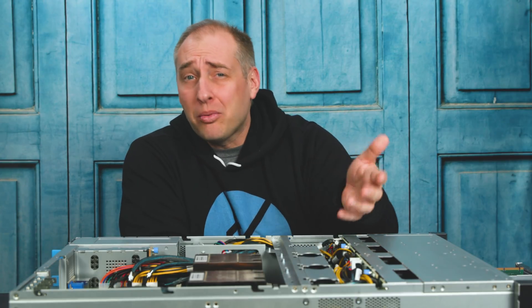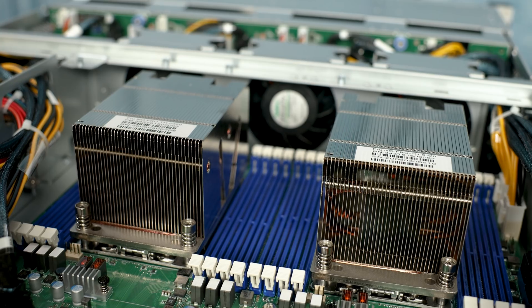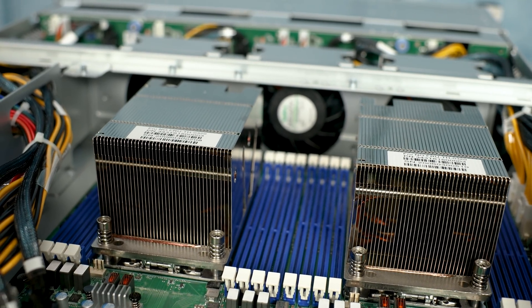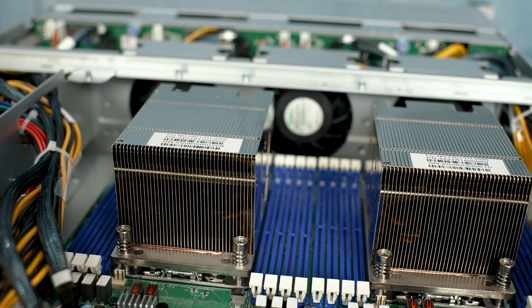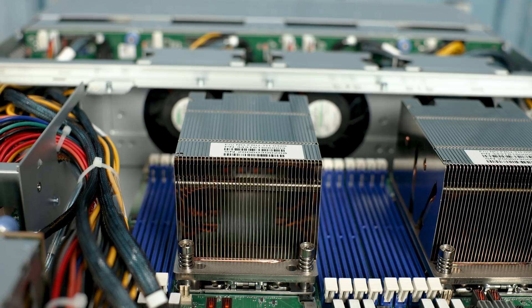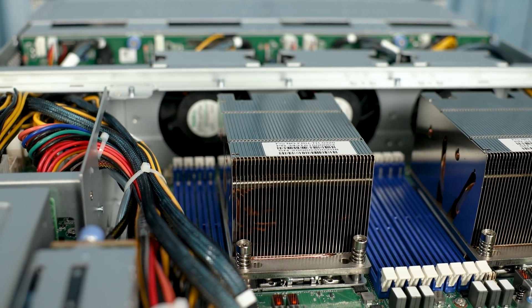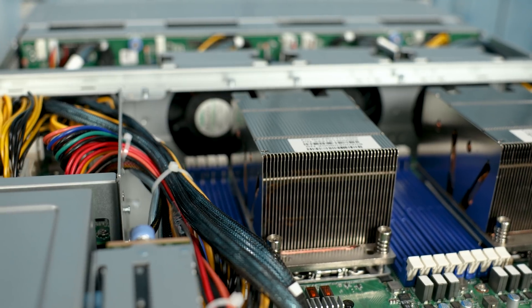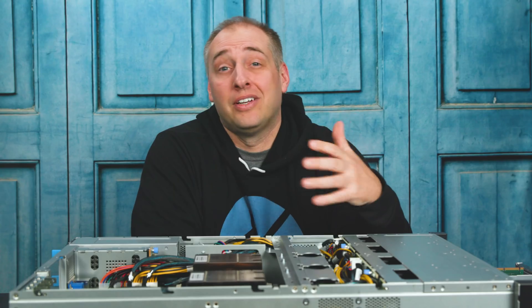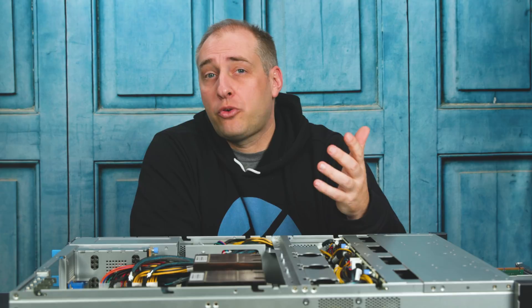In front of the power distribution is probably the biggest feature in this entire system — these two AMD EPYC CPU sockets. These two SP3 sockets can take AMD EPYC 7002 Rome series CPUs, and we expect they'll be upgraded soon to the 7003 series. The system can handle up to 240-watt TDP CPUs, giving you almost the entire range of AMD EPYC 7002 processors, including 64-core parts. For most storage applications, you're never going to use 64-core parts — you'll look at the lower-end 16-core or 12-core, maybe up to 32 cores, because storage frankly doesn't need that much CPU power. If you're buying a Tyan system and want to do something exciting, though, you can totally go up to 240 watts.